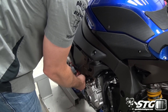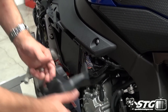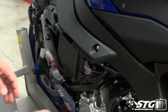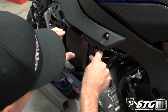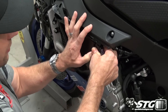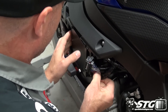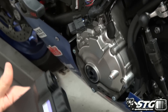Remember, with this bike I'm leaving the stock wiring harness on. You can get a kit harness, you can spend the money on a kit ECU. I feel like the bike's so good that that expense really, in my mind, isn't justified — at least not for my level of riding. So the stock ECU location — to get it off the motorcycle is not very difficult at all. I go ahead and release the connector here, release the one on the lower portion, slide it out, and out comes your ECU.